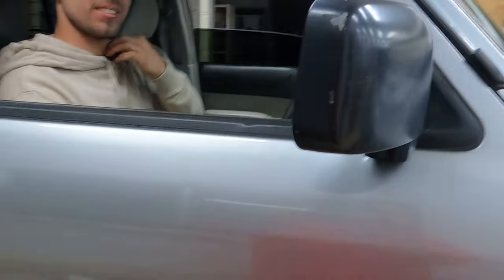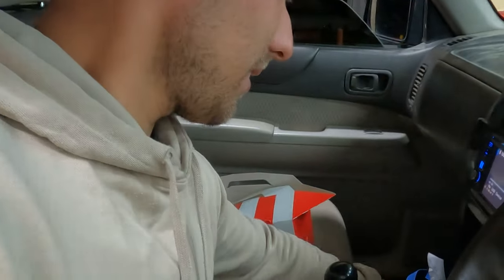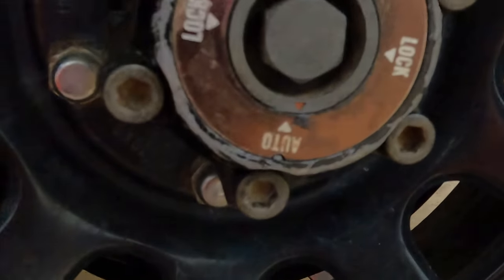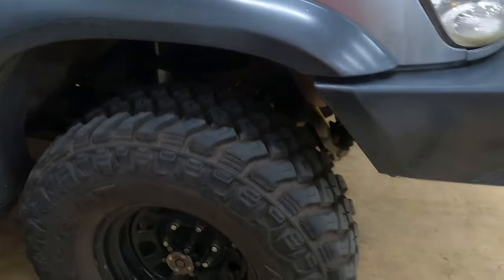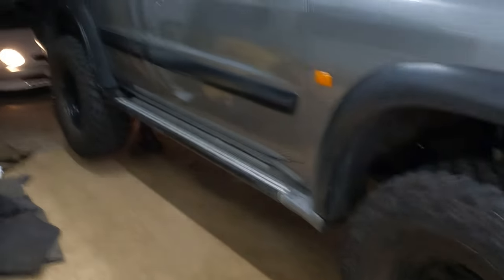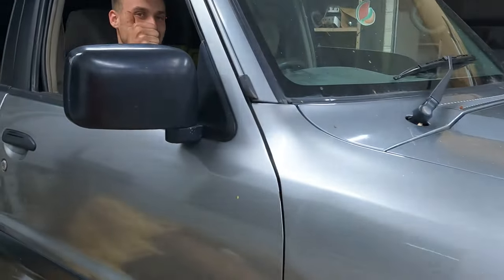Because we didn't have any jacks to put the car on, we couldn't prove it works on the day. So we're back in the workshop a week later. We're going to show you right now that this does work. We're doing a voiceover — at the moment we're in two wheel drive and the rear wheels are spinning. Dave is throwing it into four wheel drive, currently in the auto lock position. Putting it into the lock position on the hub, you can see all four wheels are turning. This confirms it is now a completely manual locking hub.